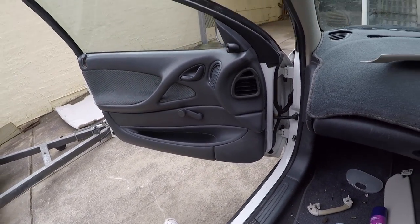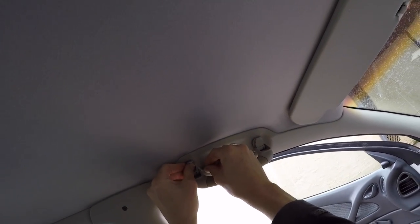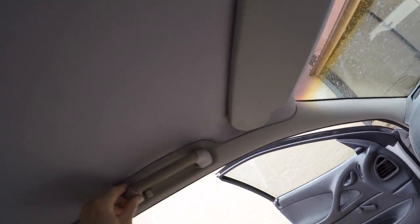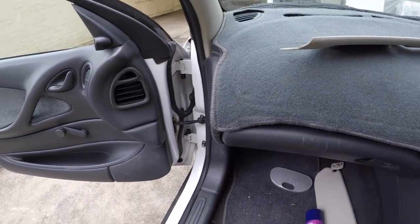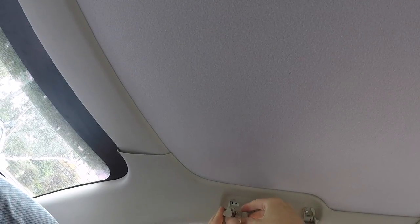As for tools for these models, you're pretty much using a Phillips head screwdriver, a flathead screwdriver, and sometimes on the sun visors they do have the T15 Torx head screw bits. Make sure you're using the correct screws from where they came from: the little black screw holds the B pillar at the top, the tiny chrome Phillips head screws hold the grab handles, the gold ones are for the centre dome light, and the super thin screws — T15 or T10 Torx — are for the sun visors.